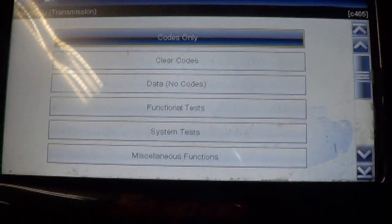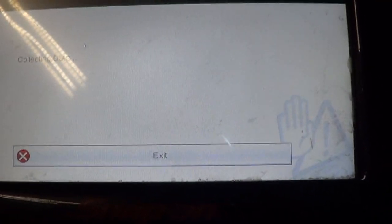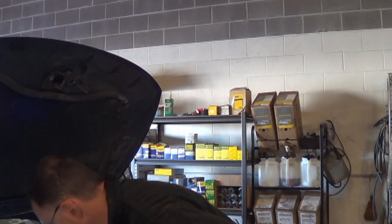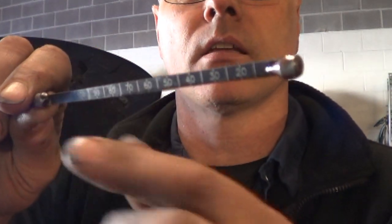We'll need the transmission temperature to do this properly. To check the fluid, you use this dipstick like any other — stick it in there until the bottom is out in the pan, make reference of your millimeter reading, then cross-reference it on the chart with the temperature, and if it's in the right range it's full. But as I'm sticking this one in here, I'm getting very little fluid on this stick at all — there is nothing on this stick except for on that knob right there.